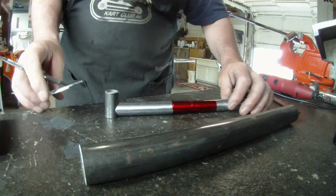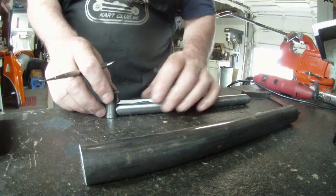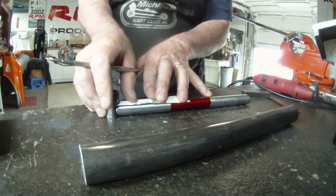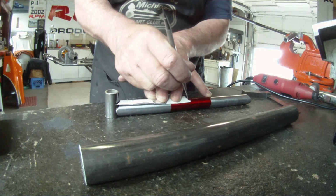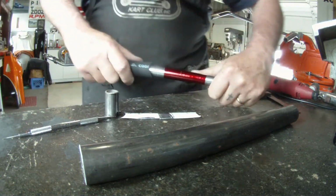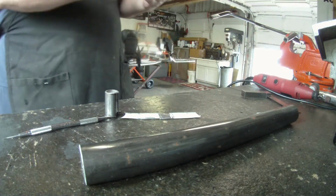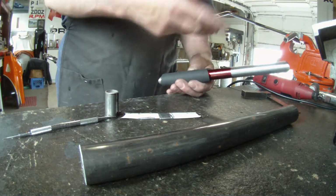Then we're going to go 180, and do this same thing tight in with the vertical tube. Get our template in there, and then we'll mark the very depth of that 1 1/8 there, and then we'll slide this on, right up to the depth there. Then we'll flip it over and see if we're close with the mark, and then scribe it all the way around. We'll just cut it right off flat, and then we'll know how to tune this up.